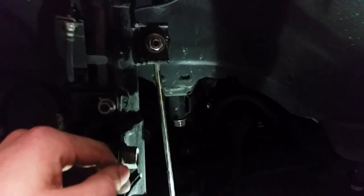So there's the culprit I'm talking about. So like I said already, checked it once by hand, seemed good. Took it on the road, still heard the clunking noise, came back, took the wheel off, rechecked it with the tools, and that's when I was able to find that I was still able to tighten it down a couple threads. So far, I haven't heard the rattling, so there you have it. Ended up being that little nut I had to tighten down on that end link.